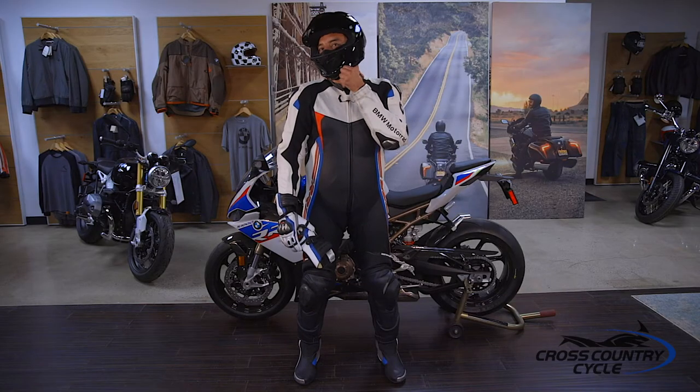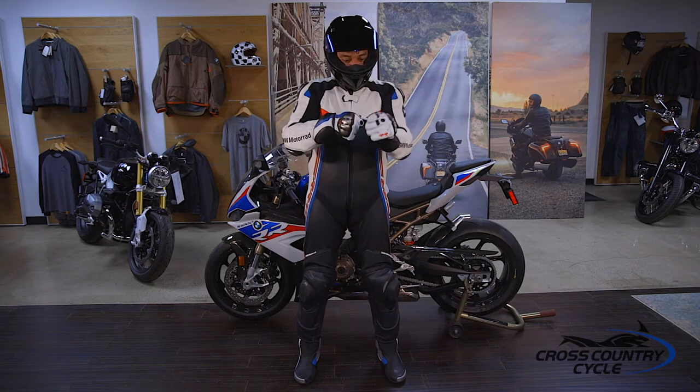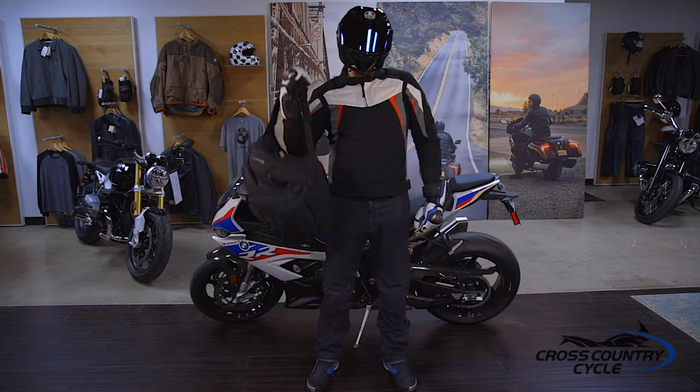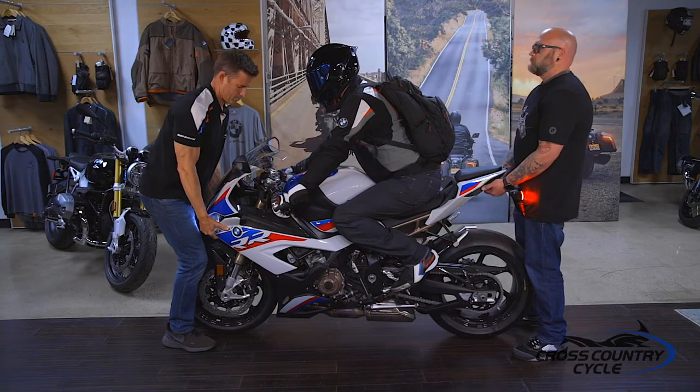If we are preparing the bike for the racetrack, the rider needs to be fully geared up in leathers, boots, gloves, and helmet, for maximum accuracy when identifying the loaded value of the rider. The same goes for the street, with the rider fully geared up and any baggage they might carry regularly. I personally like to take two measurements: one after pushing down on the bike and allowing it to recover, and another after lifting up on the suspension and allowing it to recover, then averaging the difference. This accounts for mechanical and seal stiction, and by obtaining an average we split the difference between the two characteristics for more precise values.